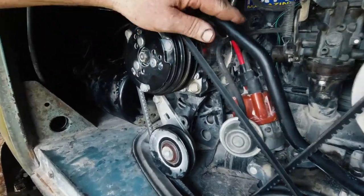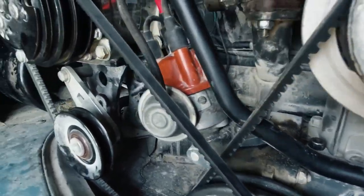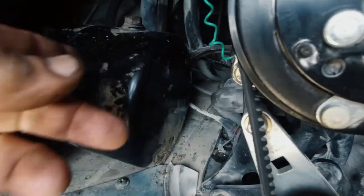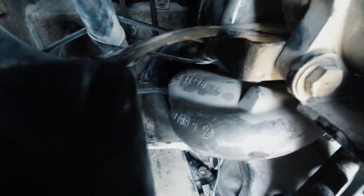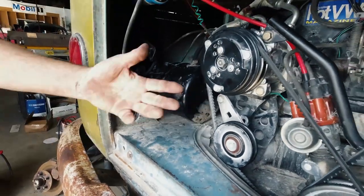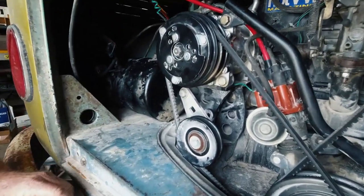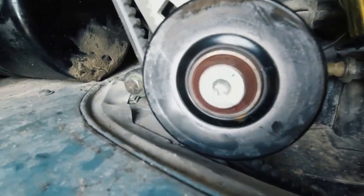I took the engine out and made this brace — it actually fit around the fuel pump before, and it has another brace on the back side that goes to the back header bolts. So I use both bolts. Some of those kits you see just use one bolt — that's one 8mm stud holding this giant compressor up. I wouldn't go that route because I don't want it to break off, and those things break off by themselves.